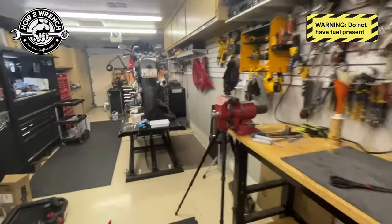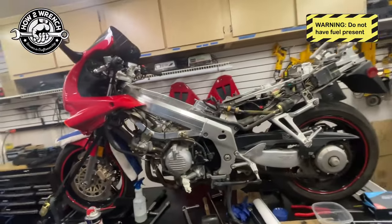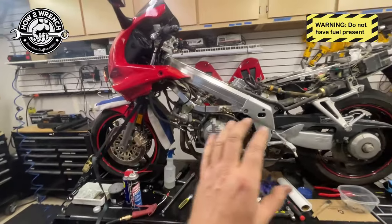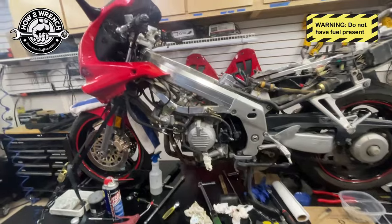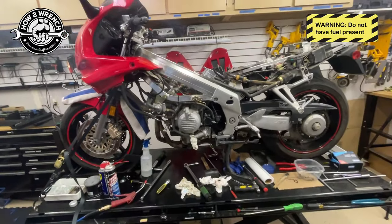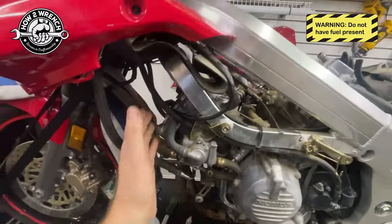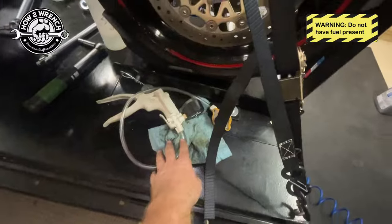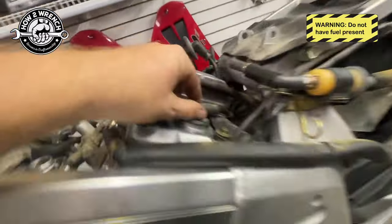The things that we do to buy a little bit of insurance — that's what we're doing here. You could call this your State Farm plan. Do these intermittent checks. Quick summary if you haven't been watching the other videos: I'm always doing compression before and after — before to find a problem, after to make sure it went away. Leak-down to make sure there's no issues after work you've done. Do a cylinder leak-down test and a coolant pressure test. I've got it waiting right here — once I put the radiator back on I'm going to do a cooling system pressure test before all the bodywork goes on.